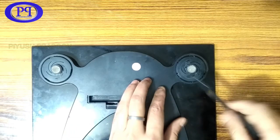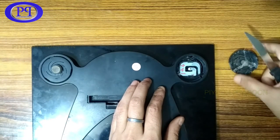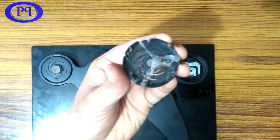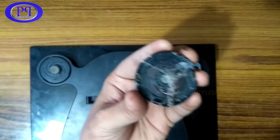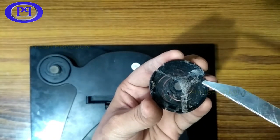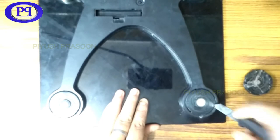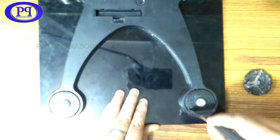I'm using a soft knife to open it up and it was not that tough. There is a lot of spider web inside — I guess there might be some spider as well, so it's too dirty. I need to clean it up first. These are the three clips I was talking about. I just inserted the knife, pressed the clip, and it came out very easily. I will do the same with all the four legs of the weighing machine.